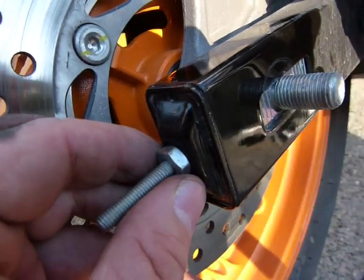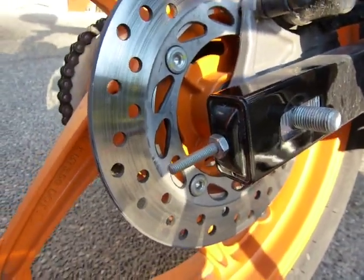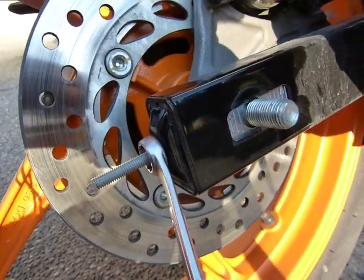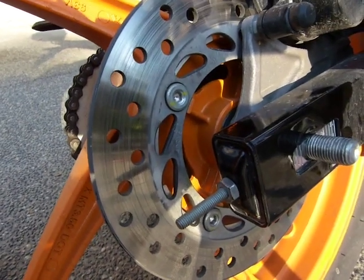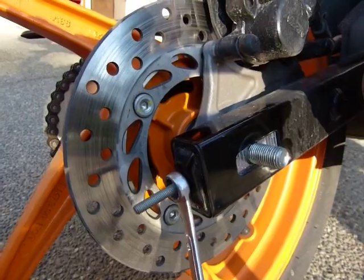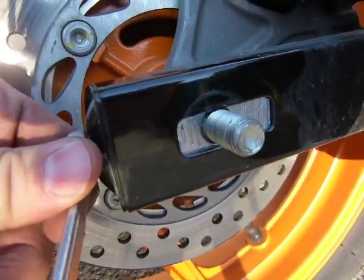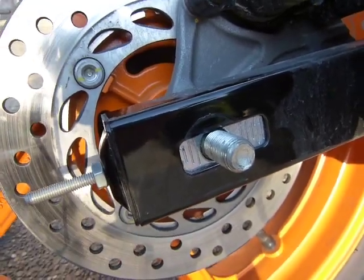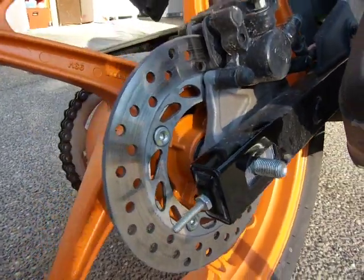This bolt is bracing against the square piece of metal that's closing off the end of the swing arm. As you advance this nut with your 12 millimeter wrench, it's going to be pulling the axle back in the slot inside the swing arm. You're going to have to adjust both of these nuts on both sides approximately a quarter to half a turn — always clockwise when you are tightening a chain. You can see the axle moving towards the end of the swing arm. I obviously took it apart and I'm going to have to find the sweet spot where the chain slack is within the specified range.